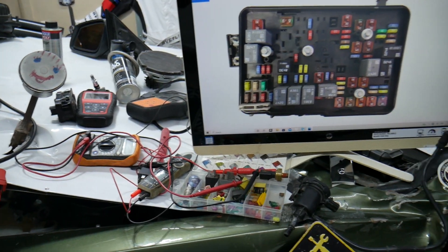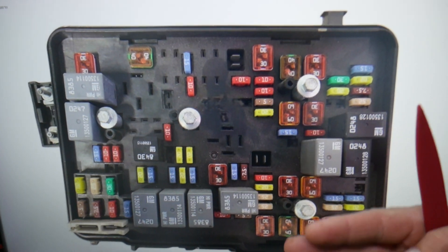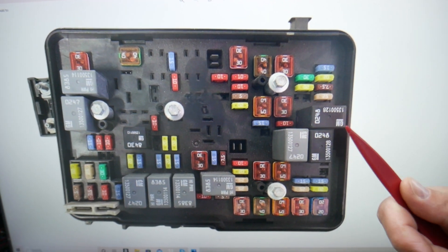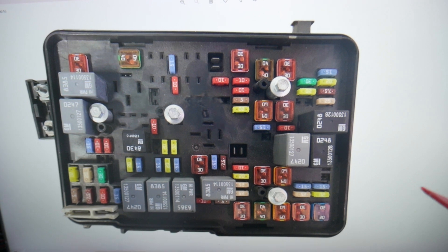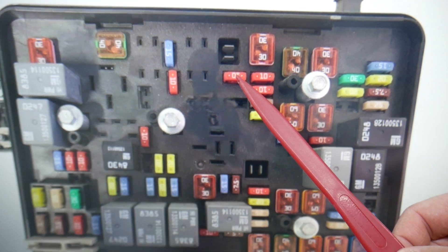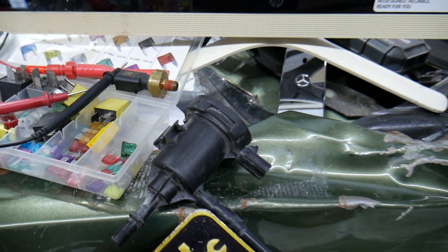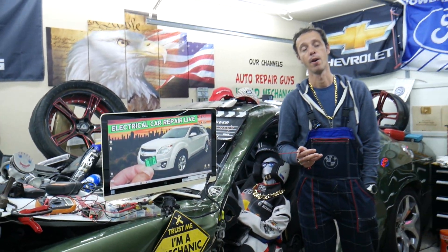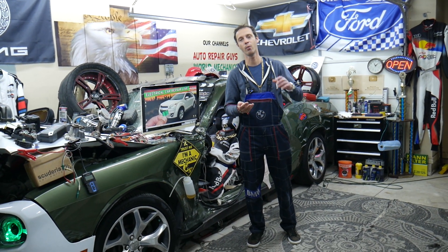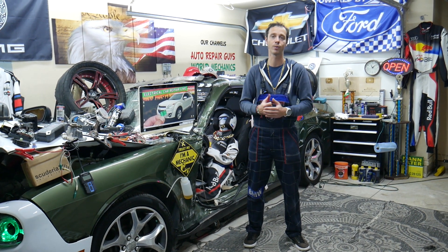It will be in the description of the video below. What do we need to check here specifically? We're going to start by checking one fuse, then we will talk about something else you need to know — information that can save you a lot of money. Coming here in that row, we need to first check fuse number 21. Right here — this is the fuse that you will need to check. Now, the EVAP system mostly consists of the purge control valve and the canister valve. For any of you guys that want to see how to test the purge valve, it's very important to test it before you buy one. There is no need to replace it and waste your money unless you have to. We'll have a video on our YouTube channel on how to test the purge control valve — check it out, it will teach you how to do that step by step.